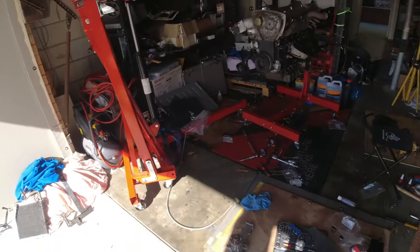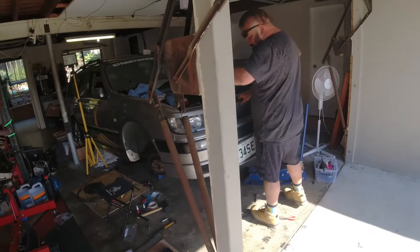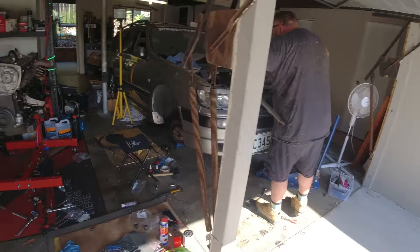Just like that we've got air conditioning. There was a bit more involved than what I filmed, but basically had to remove the auto trans cooler just to make a bit of space — plus I don't need that anymore — and remove some of the supports and bits and pieces from the front. In theory it should just slide in.